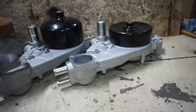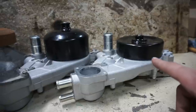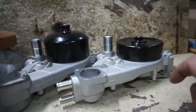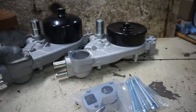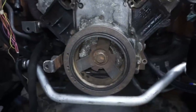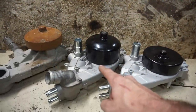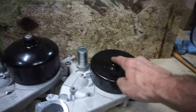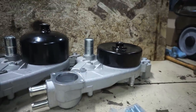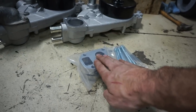You can go even shorter, which I didn't realize, or I would have done this right away. This pump is even another three quarters of an inch shorter than the LS1 pump, which requires another pulley. I bought an LS1 pulley to put on the car, so right now I have an LS1 pulley on there. I had the LS1 pump on there, but now I'm switching to the LS3 pump because I believe the nose on the LS1 pump is going to hit the radiator setup. This pump is quite a bit shorter, so I'll have a lot more space — but by switching this pump, it's not going to line up with the crank pulley.